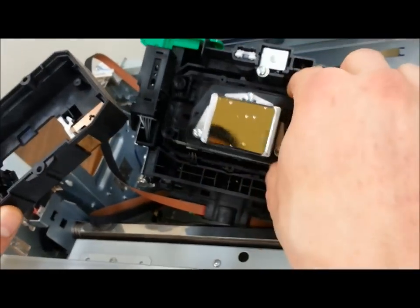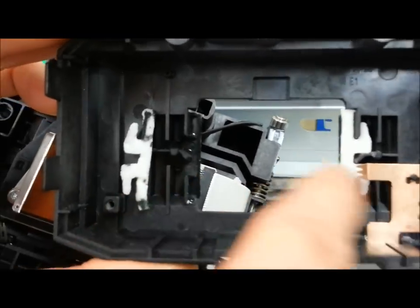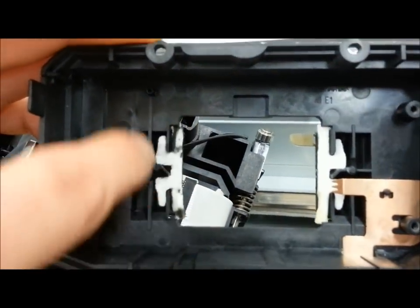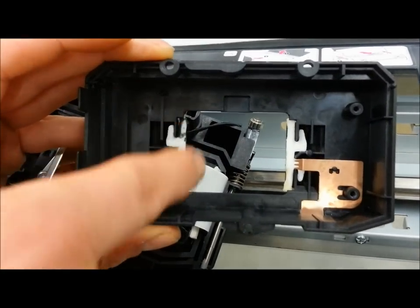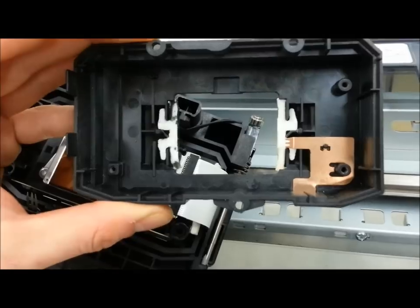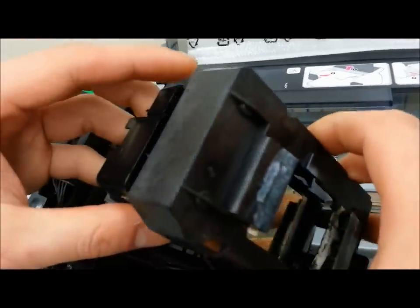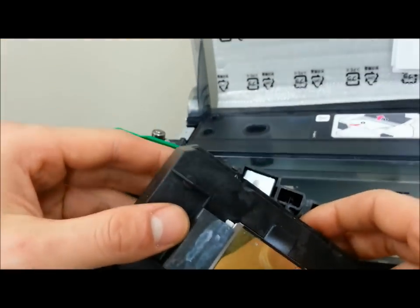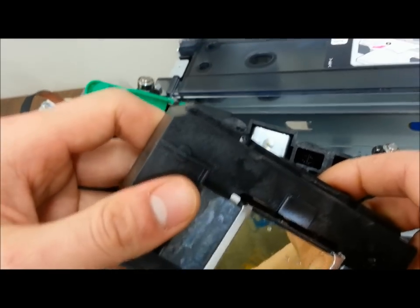Now gently place the printhead over the dampers. Inside the bezel piece you're going to see two pore pads — make sure they're in the slots, just like this. Push them in; they have a design so use logic and you'll see it fits right in. Then carefully connect the bezel to the printhead. I like this view so I can see the printhead area and make sure it's not being scratched or touched by anything foreign. Make sure the black ramps and the silver bars are completely flush.